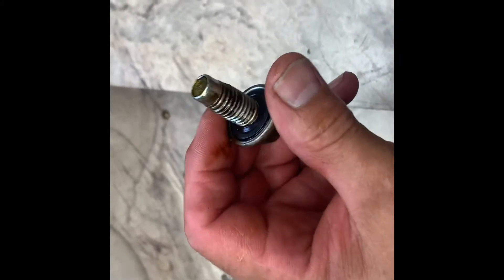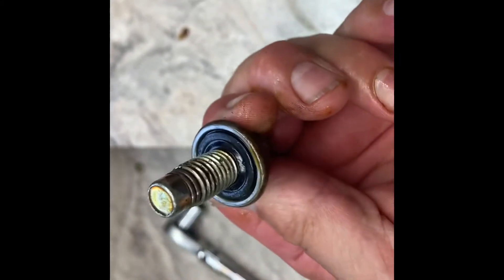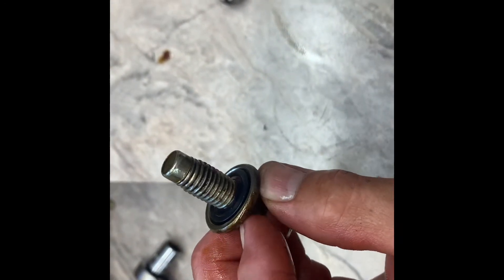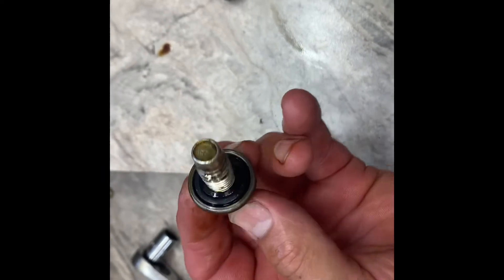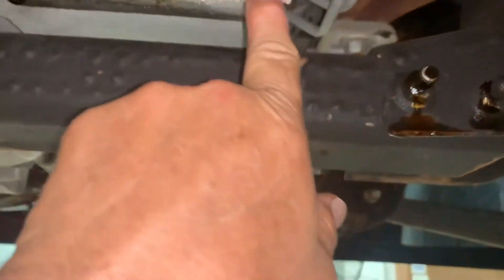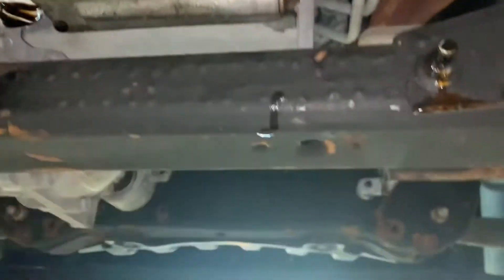Get yourself a band steel oil filter wrench — you're going to loosen up your oil filter. But first, put the drain plug back in. Before you do, make sure the gasket — actually a seal — is on your plug and in good condition. Make sure it's not stuck to the oil pan. If all that's good, install the plug. Tighten it securely — it's an aluminum oil pan, so do not over-tighten it.